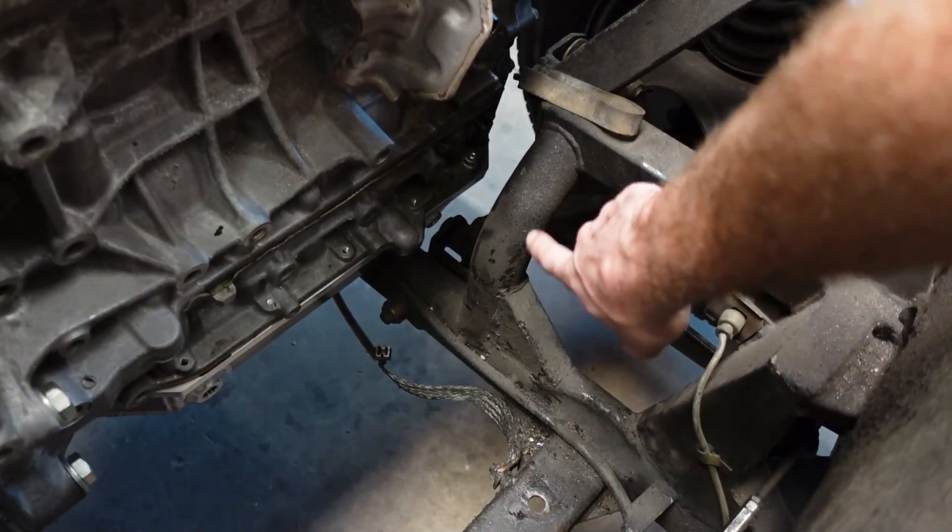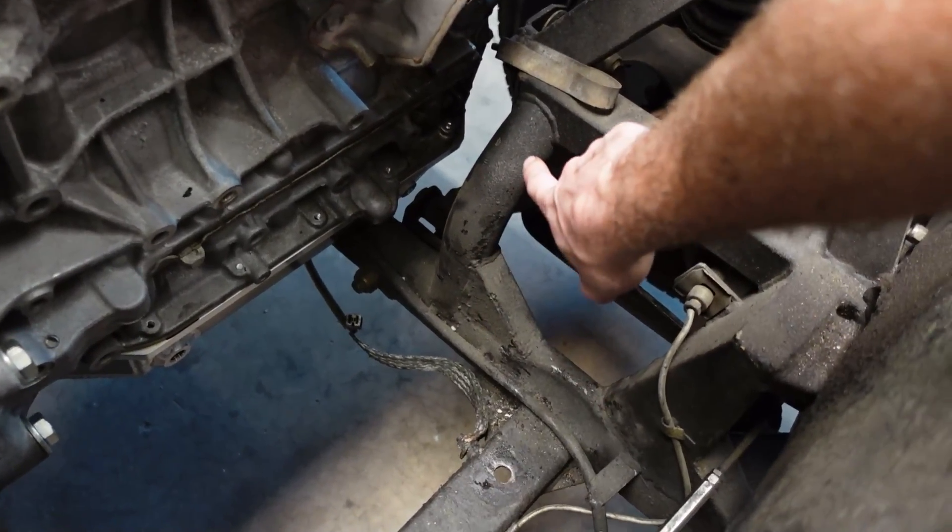In the last episode, we looked at some vertical chassis members that were in the way of the axles reaching from the transmission to the wheel hubs. What I'm realizing today is that the center line of those axles, even with those vertical members removed, is simply too high. I think I'm going to run into articulation issues with the axles swinging upwards under suspension travel and hitting the upper control arm mounts — the horizontal member that is supported by those vertical tubes. I really need to bring the height of the engine downwards.